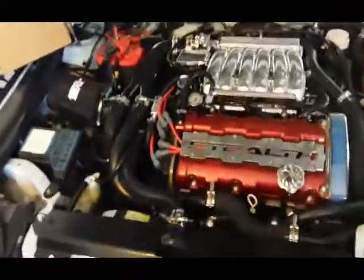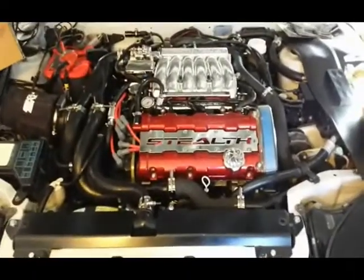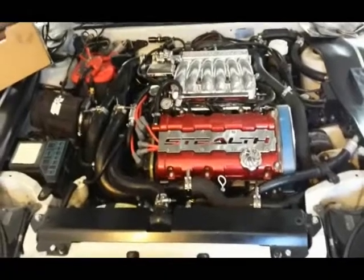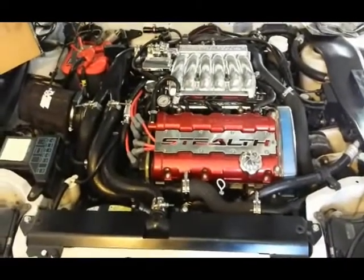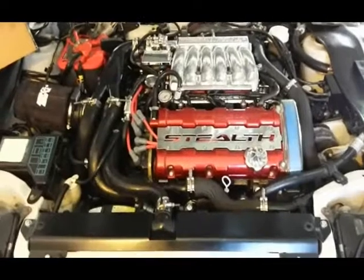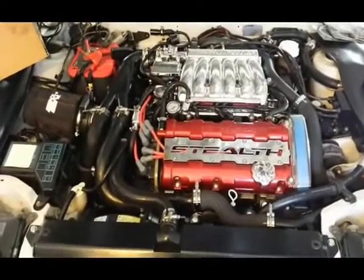But as far as power stuff goes, she's all there. I'm going to do another startup and idle, make sure everything's straight and purring well, since I'm forcing open loop. And then I will slowly begin smoothing and fine-tuning on 91 before switching to pump 85, and then the last segment will be 85 with methanol injection on top. So, might have missed a couple things. Doing the break-in tuning on BKR 7Es, we'll switch to the non-projected copper 8s NGK later. No amplifier, hopefully not necessary for the power in mind. Eddie's 99 did not need it. If anything, just new OEM coils, so they look a little better as well. But that should be about it. Stay tuned.